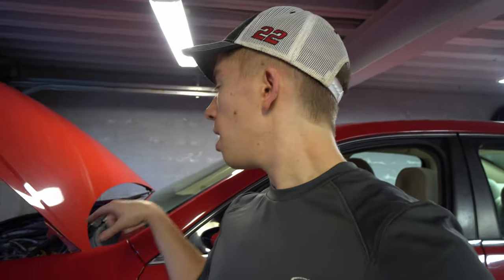Hello and welcome to Hardway Learning. Today we're working on a 2009 Chevy Impala — it is leaking power steering fluid something fierce. I'm pretty sure it's the high pressure line. I already replaced the power steering pump because it was making noise. We replaced the pump about a month ago, bled the system, filled it, topped it off, ran for at least a week, and then it was bad for a couple of weeks. I topped it off last weekend, took it for a cruise, and came back to find fluid on the ground.